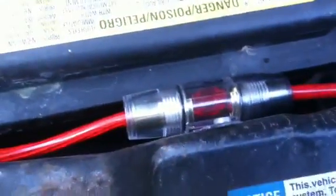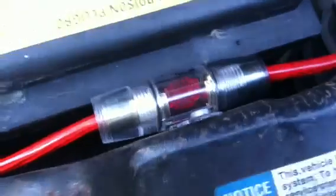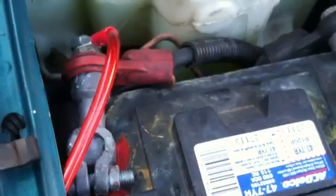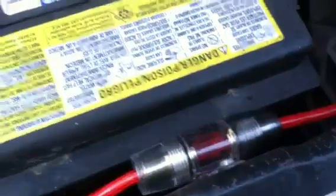I ran all the wires from the fuel cell and the battery safety fuse — 40 amps. This is a 50 amp PWM, so I put a 40 amp fuse. I'm not going to go that high with it. It should be as close to the positive post as possible, within 18 inches — keep it as close as possible.